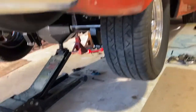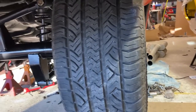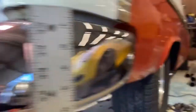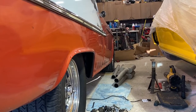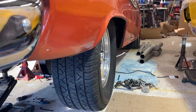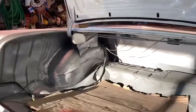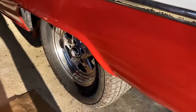I got it jacked up now because I've got to get that driveshaft out of there. But yeah, he's got plenty of clearance with a 10-inch tire. And if he decides to get a different rim, I've got to figure out what the offset is. But to keep it squared up in that wheel tub, there's plenty of room. Now the body's low with the front — I put those adjustable tubular A-arms a month or so ago, and it moved the body and the front. The car sat down low, and of course these big tires had no clearance. Now they sit real level and it's down much lower to the ground.